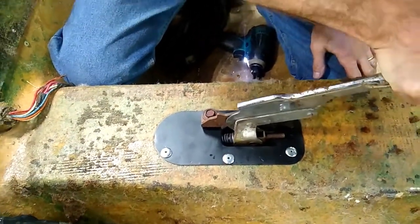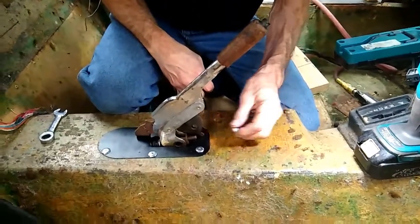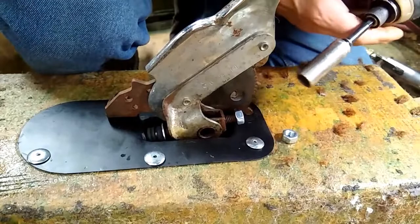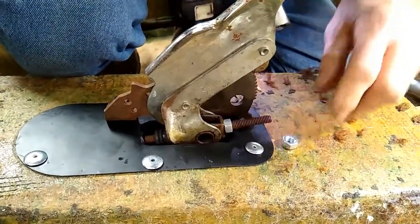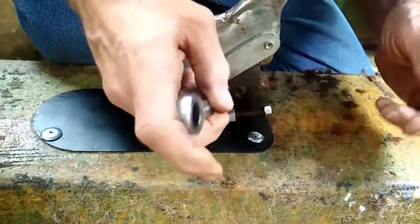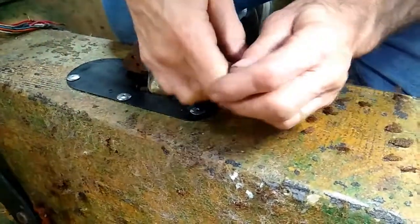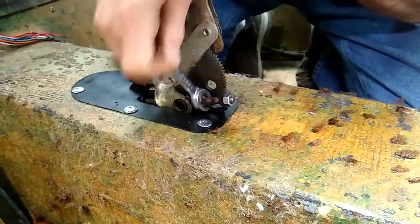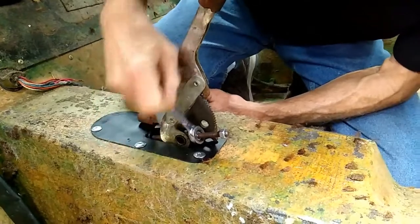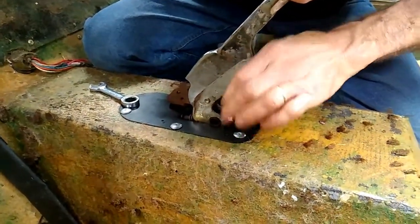The parking brake should be free moving at this point. I'm going to raise it up a little to get this to come up higher than the plate. Now we're going to put two nuts on — one is the adjuster and one is a lock nut; I'm using new nuts here. Run that down as far as you can get it with the socket, then tighten this down. Now we're going to bring it up high — we got a ways to go here. You want to get it at least where it was before, and then check the adjustment.